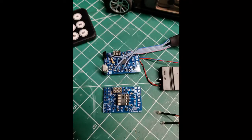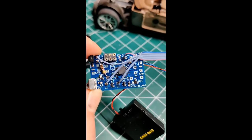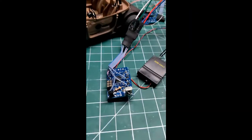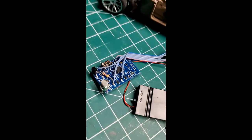For the electronics I went with ATtiny85 AVR microcontrollers and designed my own circuit board since I would be using this on future projects. The board can be used with through-hole or surface mount ATtiny85s. It has a programming block, two surface mount transistor or MOSFET drivers, and three small development areas. Each driver can connect to one of the I/O lines of the ATtiny, one driver for each side with a solder bridge to make the selection. For this project I used two of these boards, one for the front and one for the rear. I used the development areas to mount the IR receiver and some extra LED transistor drivers. The IR receiver is shared by both boards along with the battery.